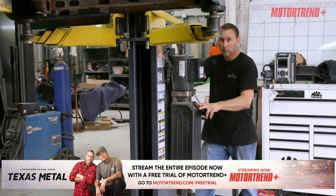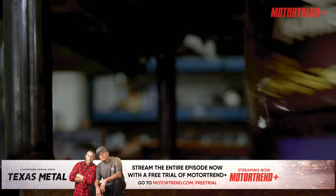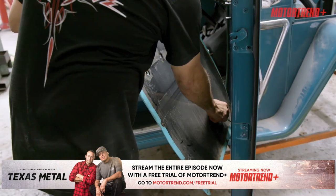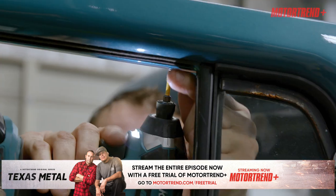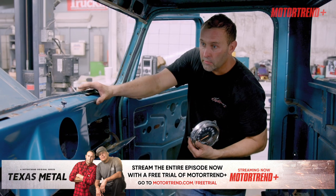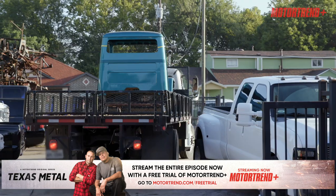We just rolled a cart underneath it. We're going to make some stands for the cart. Now we got it on the cart — we can roll it back this way. We'll pull all the chrome off, pull all the windows out, pull everything on the interior. You know, this is just one more example of how much simpler it was back in the day. Nowadays, if you took the dash out, you'd have 500 feet of wiring and sensors. This is as simple as it gets, but 60 years later it's still functioning. Now we have all the windows out, all the trim off. This thing's ready to get blasted. Next time we see it, it'll be fresh metal to metal — we can do all our metal work without any body filler or surprises.